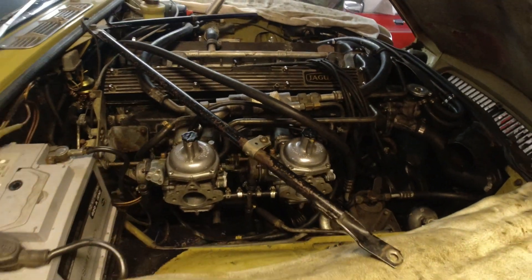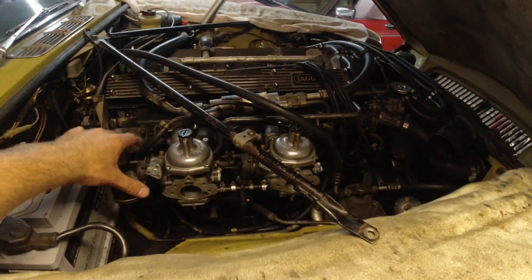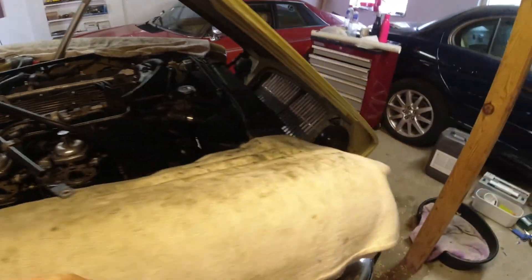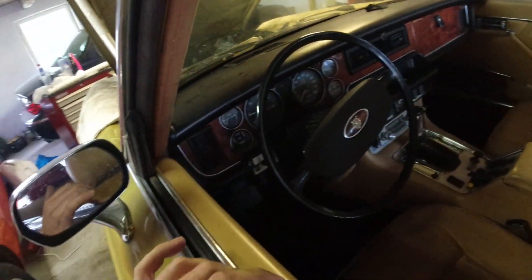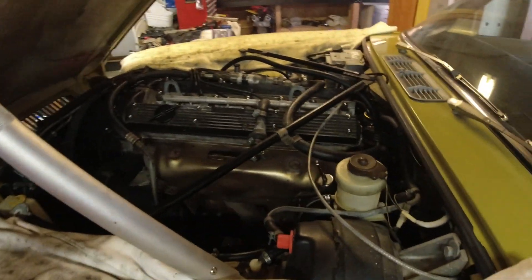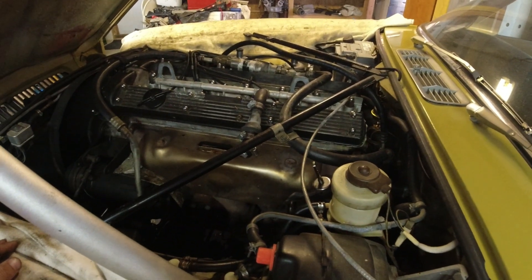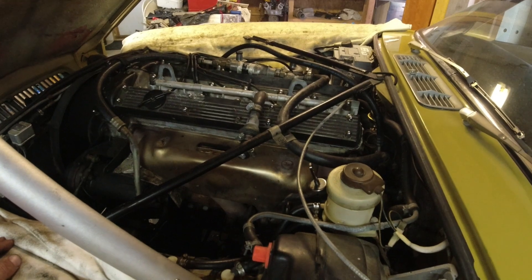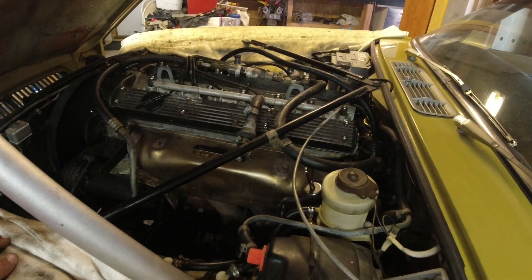It does need a full tune, but we'll let it warm up. These are starting to get warm now — this is sort of the high point of the engine, so we've got to get all the air out and coolant circulating. I don't think the temperature gauge has started to move a lot yet. We're still running the old spark plugs, which is great because we would have ruined the new ones. I haven't checked the timing because it hasn't wanted to idle slowly enough for me to do that without completely bogging down. Hopefully the chokes actually turn off this time.